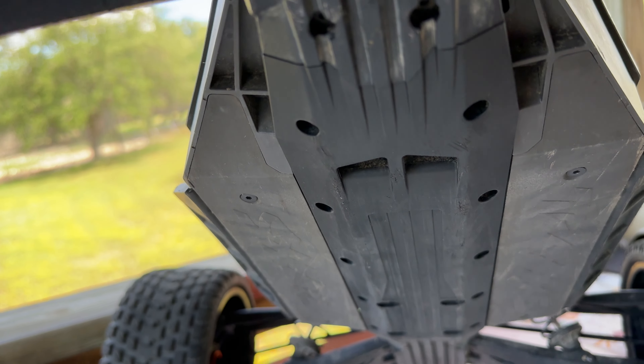I know not everybody's going to use the sway bars depending on the terrain, but it's definitely nice to have. Coming over to the Traxxas — I haven't really looked into whether they make sway bars, but if they do it doesn't come with it, so that would be an additional cost. One other nice thing on the Kraton is you can set your camber because it's all adjustable — you have the adjustable rods here for your toe-in and toe-out.